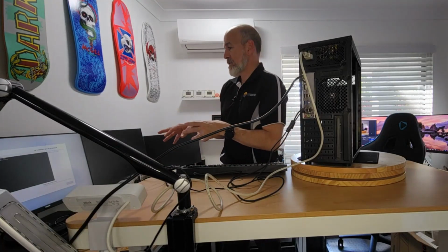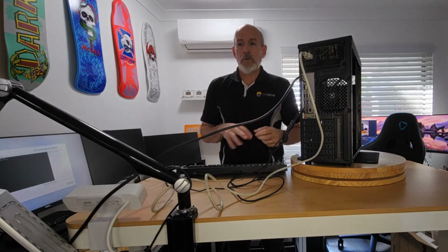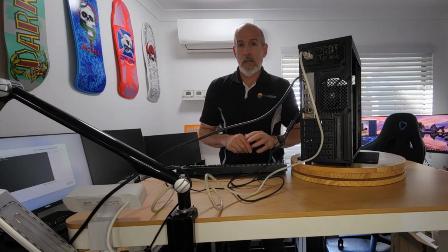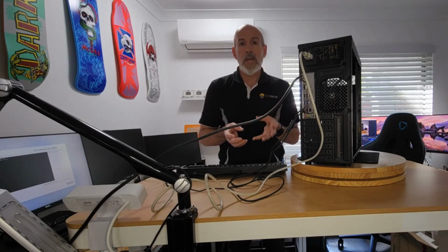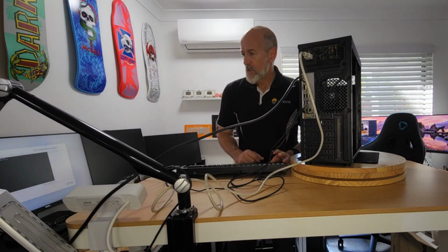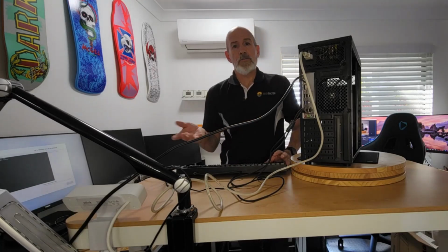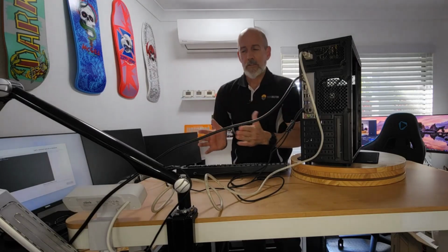As I said, you can just plug your network in and then go through as if you're setting up an account and just go no at thankyou.com, password, anything, you just smash your keys, doesn't matter. And then it's going to error because there's too many failed attempts on that account. And then it'll allow you to do a local account. And I think they should have left that option in here. We shouldn't have to be digging around to try and find it. The fact that we can do it means it's an option. So give us that option. Don't force us into being a Microsoft lackey.